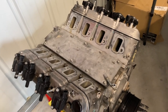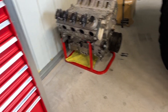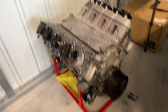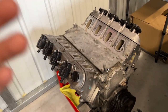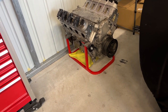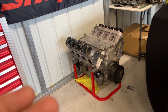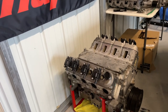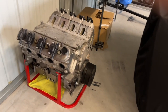The heads are good — didn't damage any of the head, which is awesome. But the short block is pretty much done. Can it be saved? Yes, it can be saved, but we're probably not going to save this one for this car. The reason being is the power level I'm looking to go after. Sleeving this block to a 4.125 bore may cause those cylinders to walk and move, and over time it could cause the engine to either lift the head or have the cylinder walk, leaking coolant inside the combustion chamber. My engine builder told me: we'll do it, but it's just not recommended at your level.